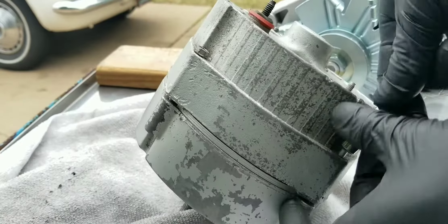All I've got to do now is actually bolt these together, throw the fan on, and throw it on the car. Make sure you don't accidentally flip this upside down without holding things in place, or the brushes will fall out. You see this hole right there — you can get a pick, and from the inside push the springs down that hold the brushes up with your finger, then slide a pick in so it holds the springs down. Once you've got everything in place, you slide it out so the springs apply pressure to the brushes again.